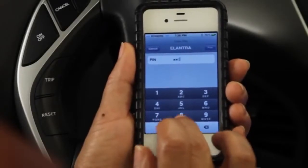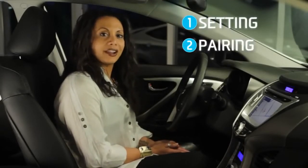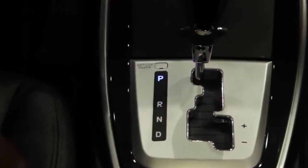Go to Settings or Setup and search for a device to add. Enter the passkey code of 0000 and accept the connection. Now, whenever you start your Hyundai and your phone is in range, they'll automatically connect to each other — that's if the Bluetooth feature is enabled on your device. Your mobile device's phone book will be downloaded to your car as soon as you're connected. The system is capable of pairing up to five mobile phones. Pairing additional phones is just as easy — follow the same setting, pairing, and adding steps as before. And remember, make sure the vehicle is parked in a safe location before beginning this process.